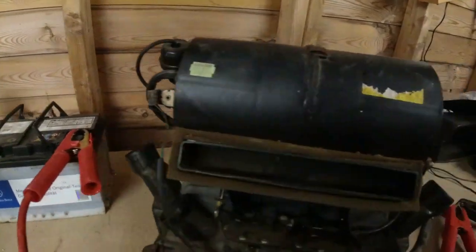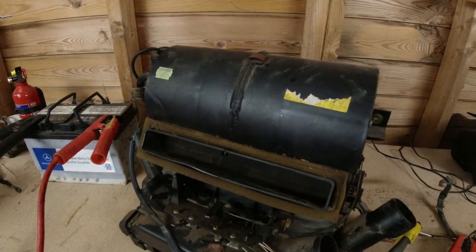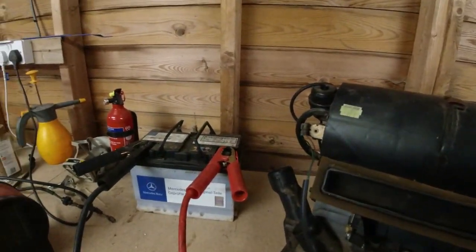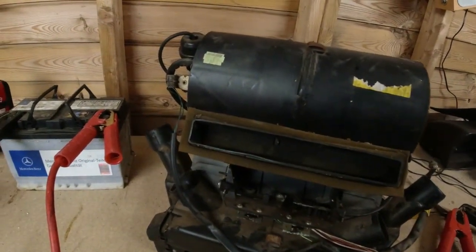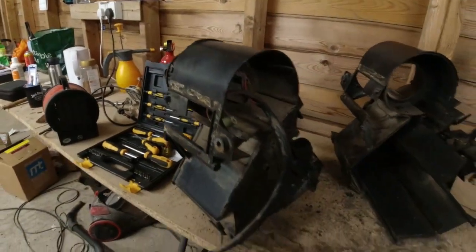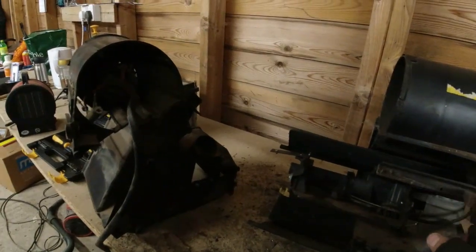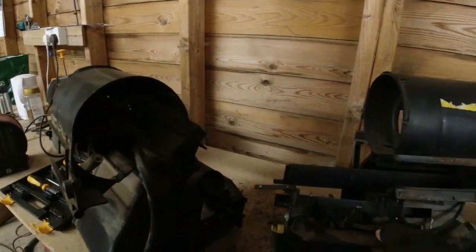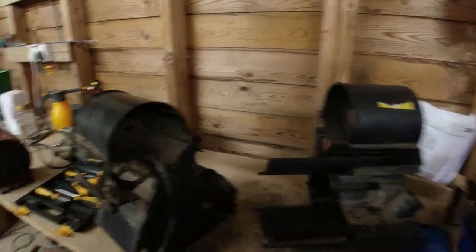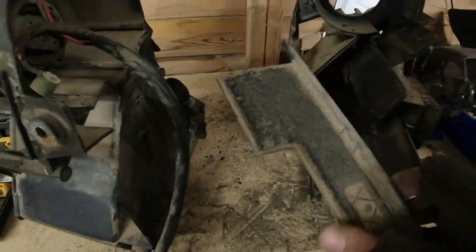It's blowing. There's no resistor on this, so it's only going to flow at one speed. It's getting faster — I don't think this thing has run in a very long time. I think we'll have a look inside it. Sometimes these things are a right bastard to get apart, and this was no exception. The only way I managed to get it done in the end was to loosen all four rivets on the front plate here, so this entire thing comes out as one lump. The overall condition inside — apart from being incredibly filthy and making me sneeze — is that it just needs a good vacuum and I'll put it back together again.